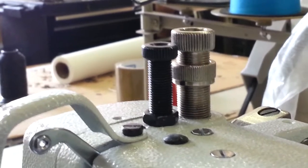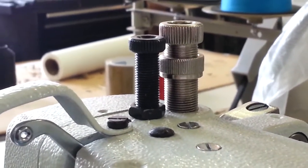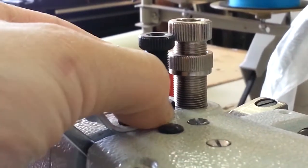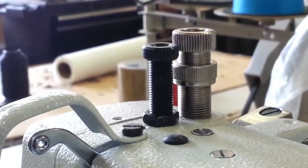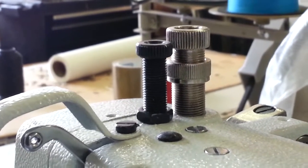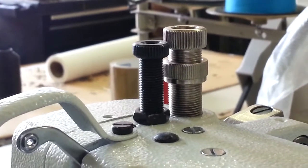If your fabric is gathering, you could release both of these. You could loosen both of these bolts — the first thing you've got to do is release the lock nuts. Both of them have a lock nut on them, and then release them up. There's no specific place I could tell you to put them.